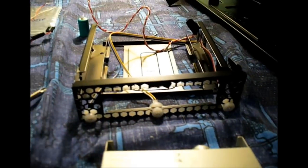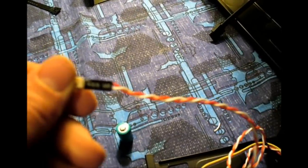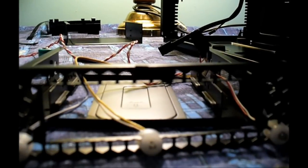And I got the hard drive light mod that I'm working on here. You can see it's roughed in. This is the part here that hooks to the main board for the hard drive light, and it even says on it hard drive LED, from an old case. And I have wired it, soldered it, and used these rubber grommets to hold LEDs. This will be my hard drive light, and the floppy drive will slide right into here, and then that will be in front. And here's how it looks so far. It's gonna be pretty cool.